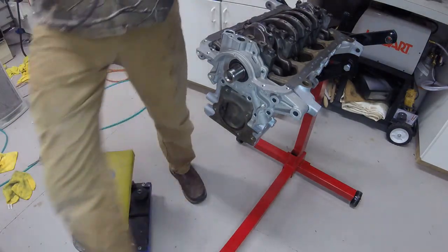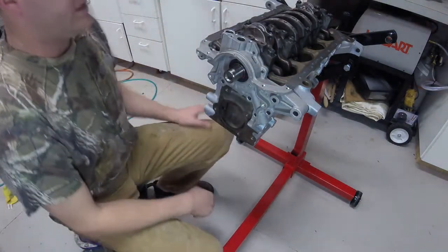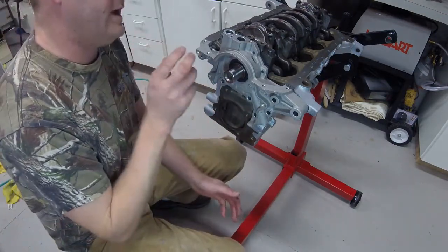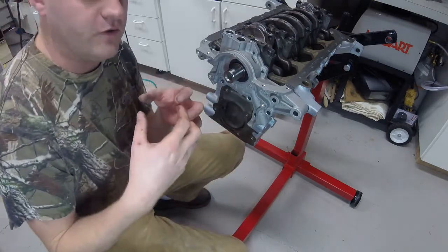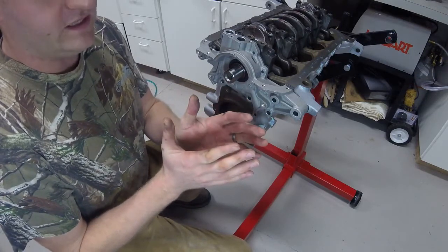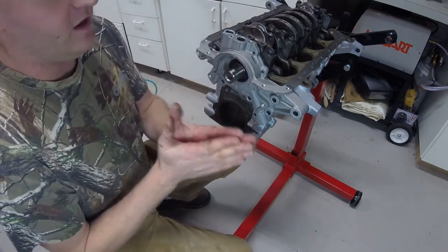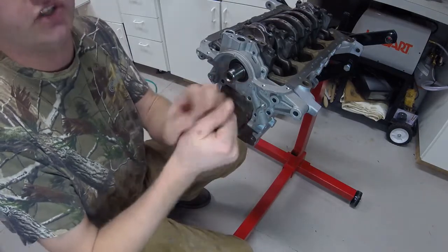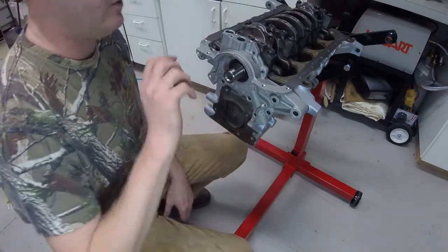One thing about Ultra Black RTV — you do not want to torque it down initially. A few of Permatex's RTVs are like this: just do finger tight until some gasket material pushes out. Then after an hour, once the silicone is starting to harden and skin over, then you torque down. That way the silicone has already formed a rubber-like seal getting compressed, so it's not just squirting out from the torquing. I'm going to get the bolts in, get it finger-tight, let it sit for an hour, then torque it to the block.